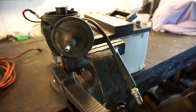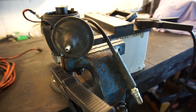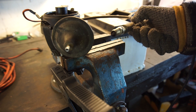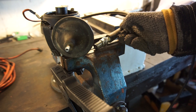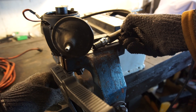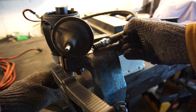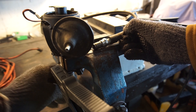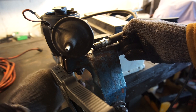I'm going to complete the circuit now by connecting up the negative of the battery terminal. I also put on some gloves just so I don't get a shock. So you see here - it's a spark plug. I'm going to ground it out on here, so imagine that this is the ground from the cylinder head. And then I'm going to go around here, spin the bottom of the distributor, and try to spin it pretty quickly. Have a look here - see if you can see a spark. I hope that you guys can see that.